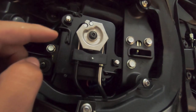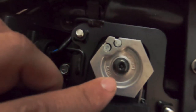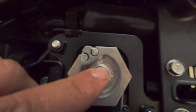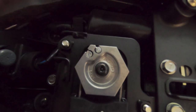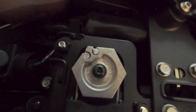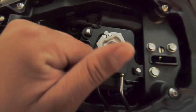Now we're going to attack the servo motor. It should be this 10mm — that 10mm. I do have the tamper-proof torx bit, since there is a little dot there in the middle, to get that off so I can get the actual cables off. Then we can remove the servo. I did get a servo buddy — I would highly recommend you guys wait until you get your servo buddy to install the exhaust so you don't throw any codes, especially on a newer bike, because it does store it in the log for the ECU. I'm going to remove this and then attach the servo buddy.